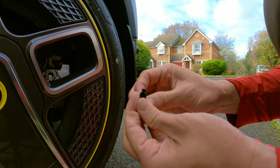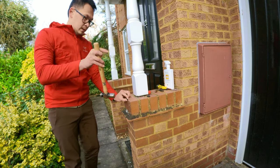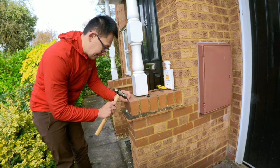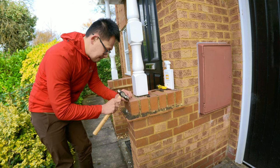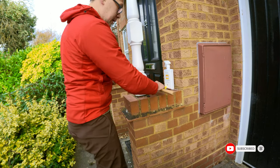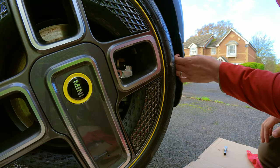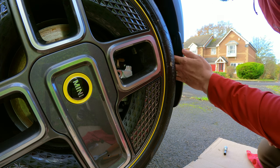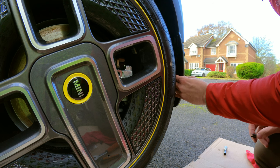The hardest part of this installation is putting the clips in. I discovered a trick: use a hammer and place the opening of the pins against a brick, then slowly tap them so the gap widens, making it easier to insert the pins. You can see the one on the right has a slightly bigger opening. Then I bring the clips and start installation — it's easier if you remove the wheel for more room, but with the widened pins I can just push them in and use a stubby flathead screwdriver to seat them.